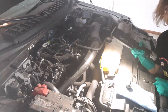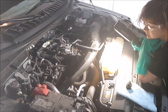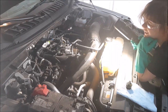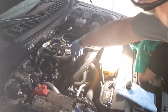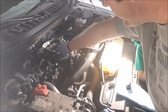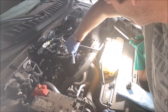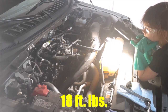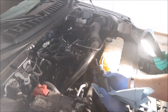Here we are on the top of the truck. I just opened the drain plug and made a huge mess. I'll have to clean it up better once we move the truck, but we need to go ahead and disconnect the upside-down oil filter housing. It is a 27mm socket. You'll hear a little bit of oil drop into the pan underneath. I've been having the dealer change the oil and they got this on their gorilla-tight. I'm sure there is a spec, but once we replace the filter, snug will suffice. There it is — the oil filter housing and oil filter.